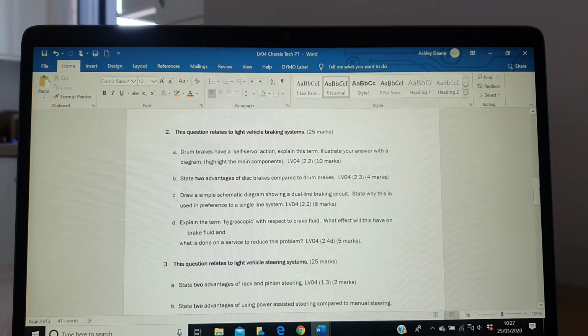We're looking for 2 different braking lines that are dual circuit, which allow the car to still brake in the event of an accident, okay? So that's why we're using it, and that's what we're looking at. There's the X split or diagonal split, and there's front to back. You'll never have a side to side, and you can have a look at why and what that would cause.